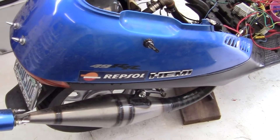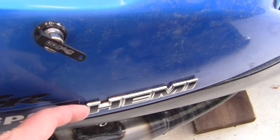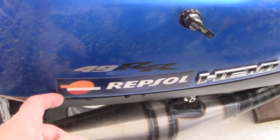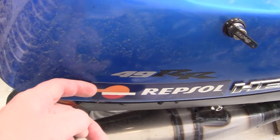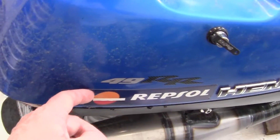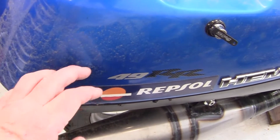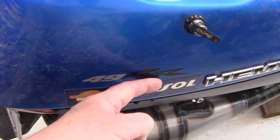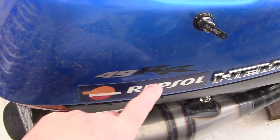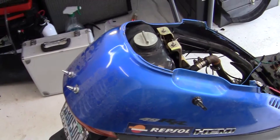What I plan on doing, after I pick the color, is I'm going to slowly take this off — it's on a sticker — and I'll take the hemi emblem off. These items right here, I will lightly sand the edges. They have a lot of clear coat on them. The trick with these is you have to be very careful when you sand the emblems, because you'll have a ghost. I can sand this almost all the way down to bare plastic, and there'll still be a ghost of '49RR' that will show up in the next paint job.